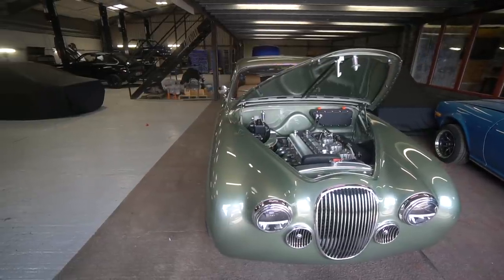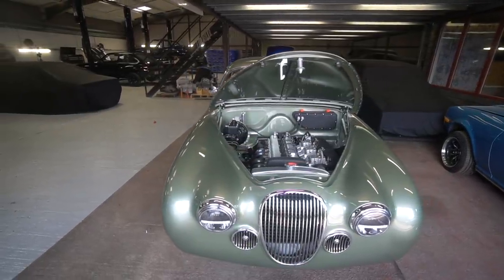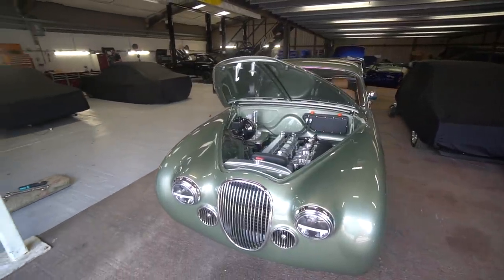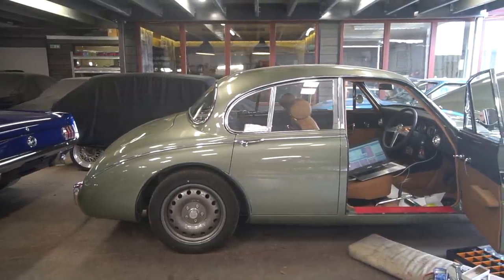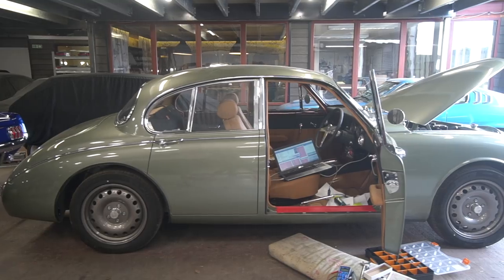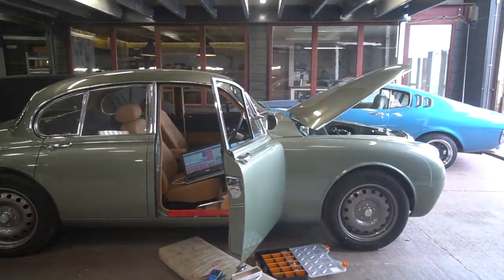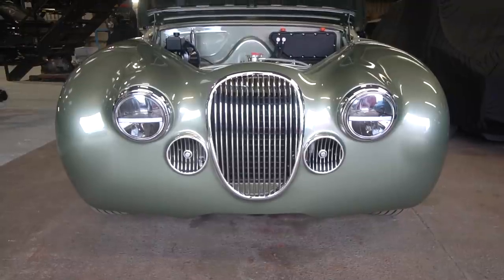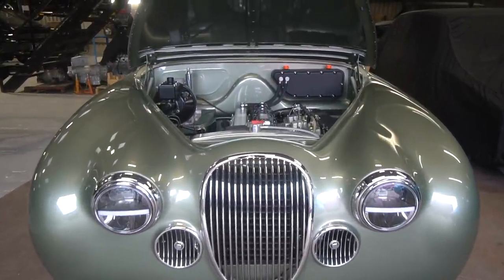Utah — I've been out in this and did a pretty decent test drive the other day, probably 30–40 miles. Generally good, but we ran into the same clutch problem we'd had previously, which we'd narrowed down to being the master cylinder and replaced it. The problem came back — exactly the same problem — where the fluid wasn't being allowed to pass back to the master cylinder when you release the pedal.